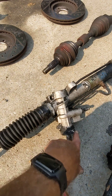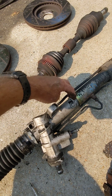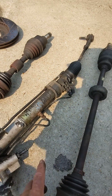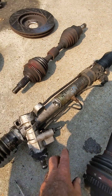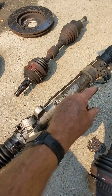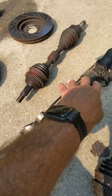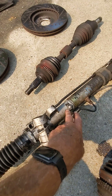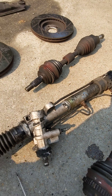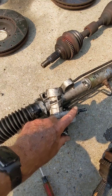The pump section is probably okay. There's a piston in here with basically two chambers — one chamber on this side and one on that side. When you turn your wheel, it directs fluid flow into one side or the other. Higher pressure fluid on one side pushes it this way, higher pressure on the other side pushes it that way. Pretty simple — it all has to do with this portion here.